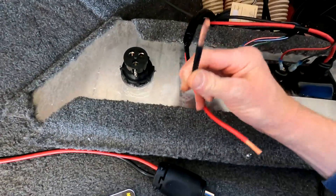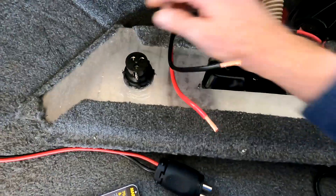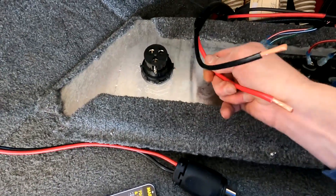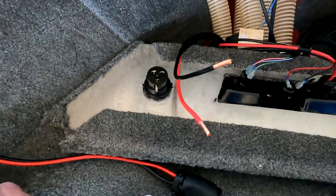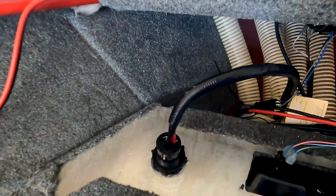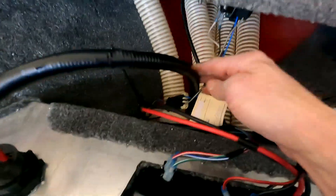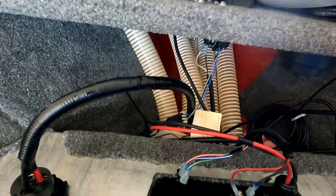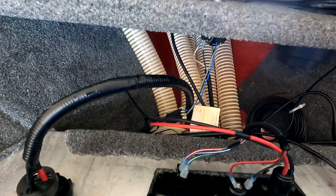Okay, I'm back up from the front. I'm gonna wire this receptacle up — this goes to the trolling motor batteries. I got these peeled back — you stick them in the holes right there and tighten the allen screws up and it tightens down. I got it all tightened up with the plastic casing wrapped, and I don't think I need to do anything else in here as of yet. I'm gonna put this back up.